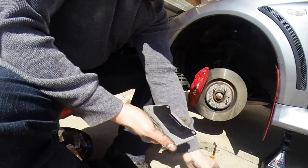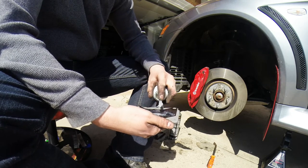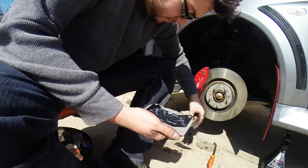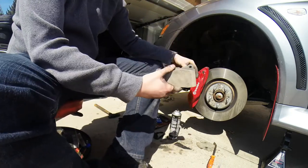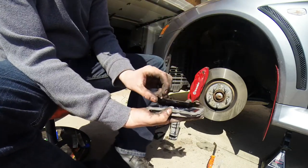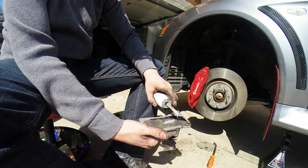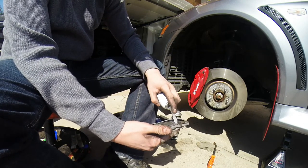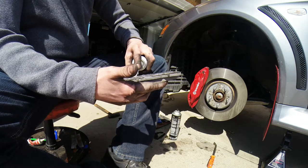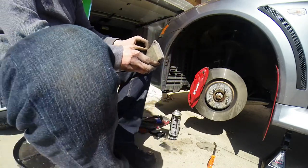Now we're going to be doing the inboard pad first. Here's your silicone. Spread it around there. And so this is going in this way. We want the shim. It's going to be the wrong shim. We want this shim. Sit that right on top. We're going to use a little bit more dielectric on the outside of the pad, and that shim. This stuff is a little bit stickier than your normal purple stuff, so it will actually hold the shim in place till you get in there.